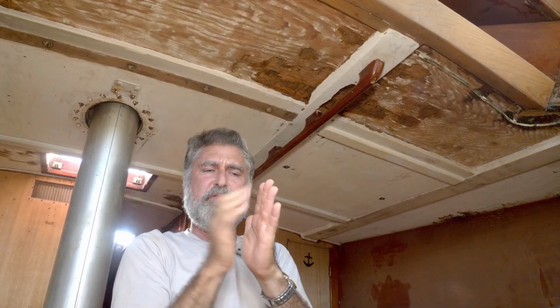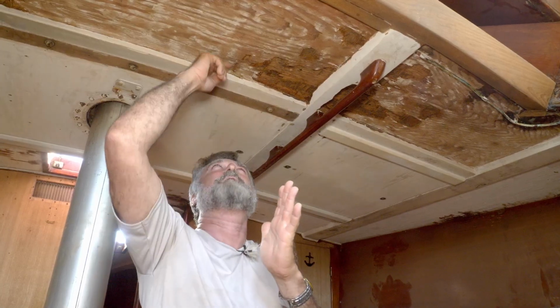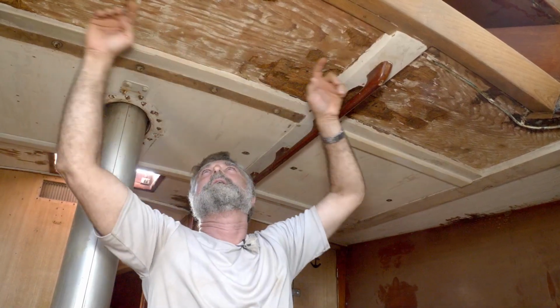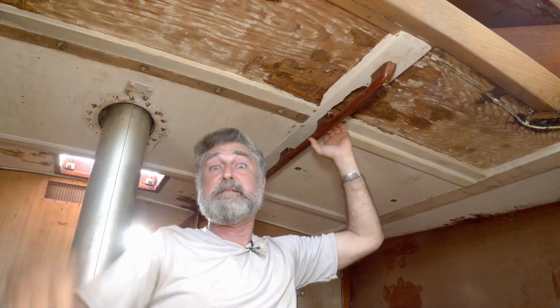It doesn't matter the strength of the inside so much, it's the 2 outside layers that matter. And this is fiberglass and good plywood above, and then it's going to be a good plywood below. So this deck here is going to be significantly stronger than she was designed to have.